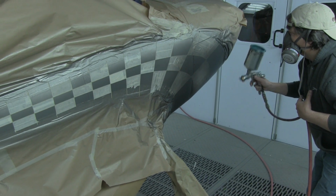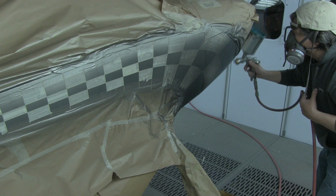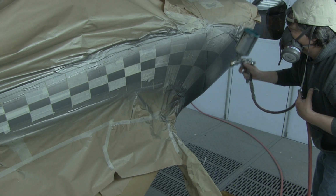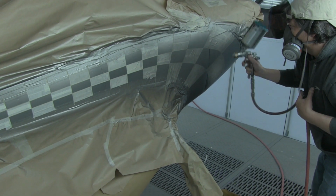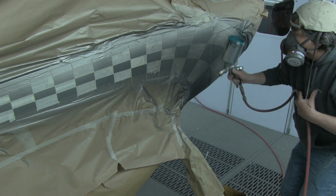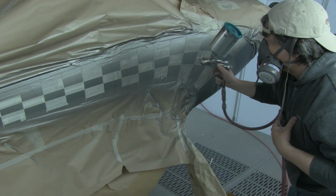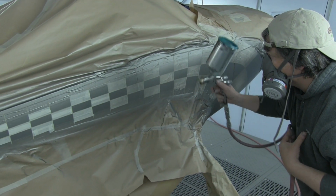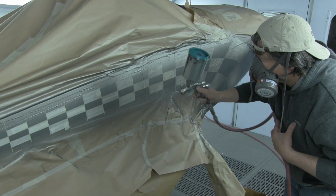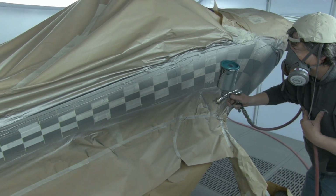It's the same fade, guys, fundamentally exact same fade. Coming in with a big gun, the 1.3, no reduction whatsoever, but I'm just using that 20% 40-30 to control everything. I can fade this, I can stop, have a cup of tea, regroup, have a think about it. I have the luxury now because I've increased the transparency, so I can just build it up and build it up. The key to doing big fades like this is patience. Just take your time and just let it paint itself.